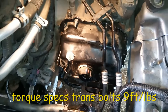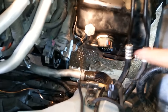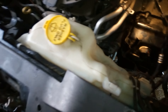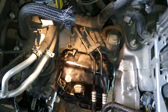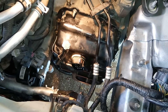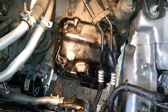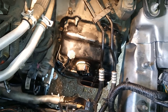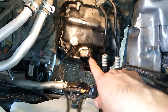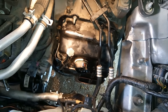The transmission pan is back on the transmission. Make sure you put everything back — the radiator hose back in place, the screw in your washer fluid reservoir, all the things that you removed. The RTV usually needs to cure for 24 hours before you put any fluids in, so we're gonna wait 24 hours and then pour the transmission fluid back in since we'll lose some. Connect the connectors back, put everything back in place, wait until tomorrow, add the rest of the fluid, and test the truck.